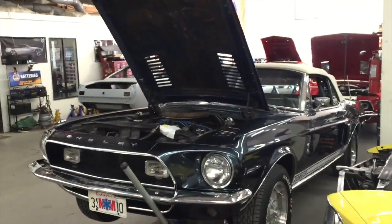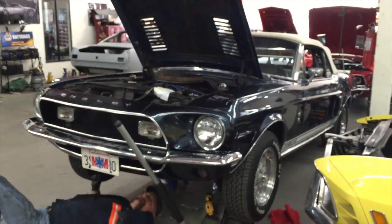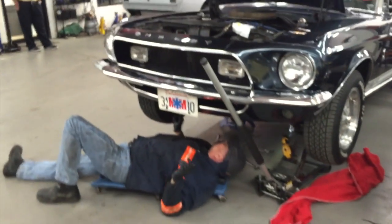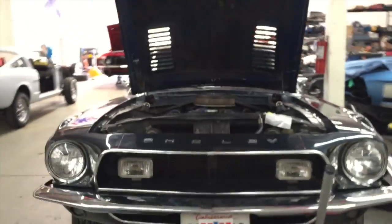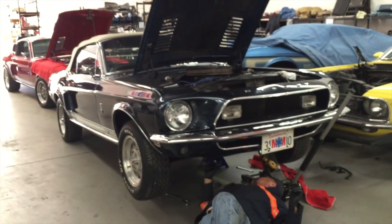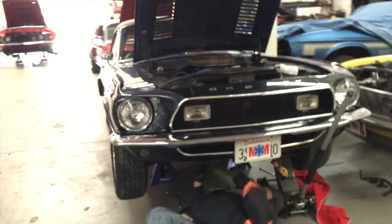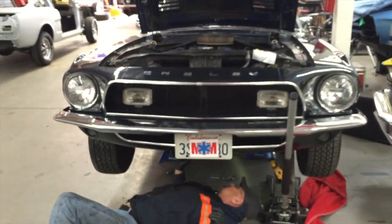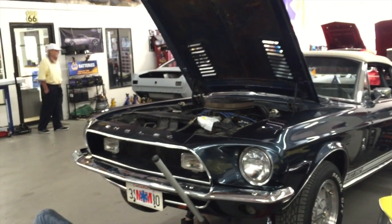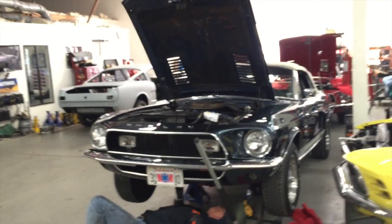We have to deal with the restoration thoroughly — test your stuff, get it down the road and run it, see what you've got. What we found out is on a 68 Shelby with a power steering line, you cannot use a standard 68 power steering line. You need to use a Boss 302 setup — it's two lines — and it has to have enough motion. If you put the regular 68 power steering line, the steering going back and forth will eventually twist the line, snap it, and then you've got no power steering.